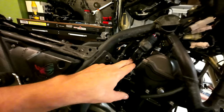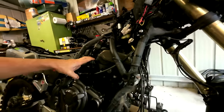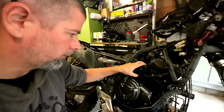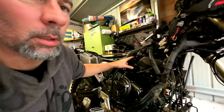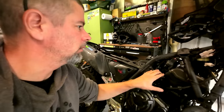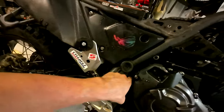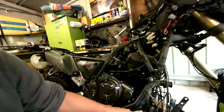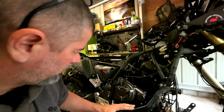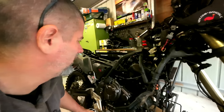The throttle bodies will have to be undone in here. I don't think the chain will need to come off or anything like that. I'll undo what looks obvious and then start taking off these engine mounts — there's another one in here that will have to come out. Then just slowly drop the jack and see if it starts moving, making sure everything's not getting damaged.